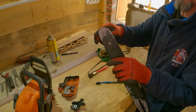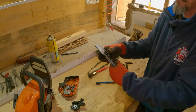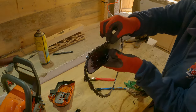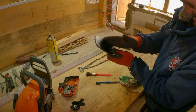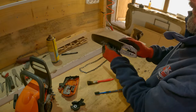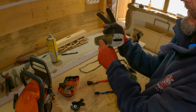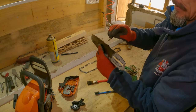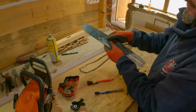If that star wheel isn't spinning freely you might need a new bar, because that's what the chain links sit in when it rotates round. Now with the chain on it — there's quite a lot of rock in there. These teeth run inside the bar, and this edge runs against the top of the bar. Through use and wear, the chain running along here can wear the bar out at a funny angle — the inner edge wears away and the outer edge is slightly higher. I've got a burr edge on there which needs treating.